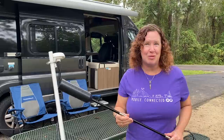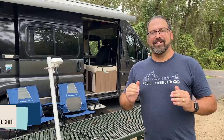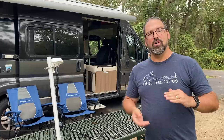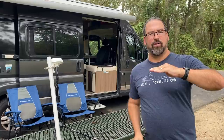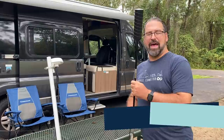Chris is going to share some tips for getting it up. The key is getting your antenna above the obstructions around you — on your own roof or the things near you. The simplest approach is a low-profile antenna mounted on your roof, spaced as far from other obstacles as possible. Or put it on the highest point of your roof, which in many RVs is the top of the air conditioner shroud. These low-profile antennas only add a couple inches of extra height, so there's minimal risk. Mount them there, route the wires inside, and you've got a 360-degree view.